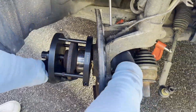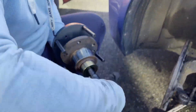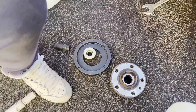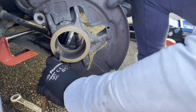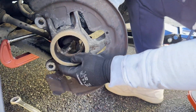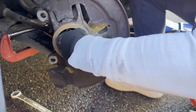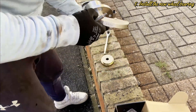It takes a decent time to remove it, so please be easy on yourself. Once you are done, clean the wheel hub hole with a wire brush, but be mindful of the ABS sensor if you haven't removed it. In my case it wasn't that bad, so I didn't need much effort. At this point, half of the job is already behind our back.